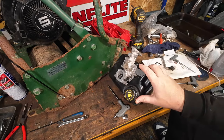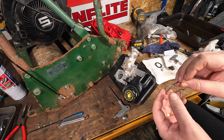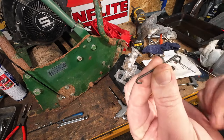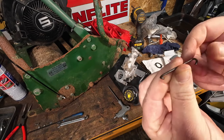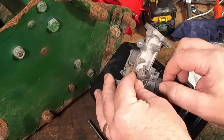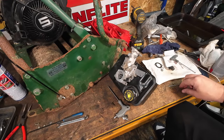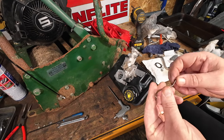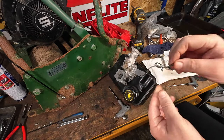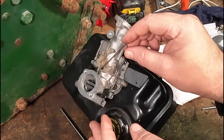Now I want to hook up my governor arm and my throttle and my choke. So you've got this one here, which is the straighter arm of the two, with two little tiny bends either side — one bend going down, one bend coming out this way. That one is going to go onto the throttle arm just here. And then the second one has a Z-bend one end, and then it goes down and curls up and round. This one goes through the choke like so, and then sits in there like that. That's how they go.